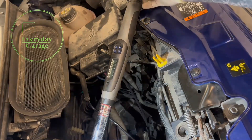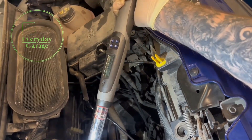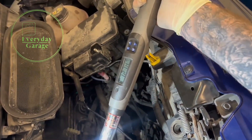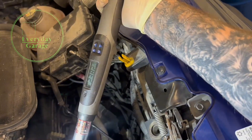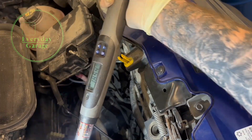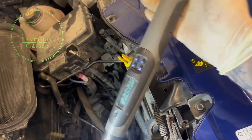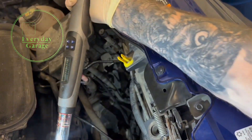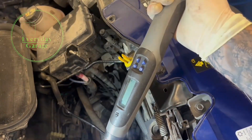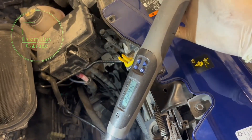Working on the first of these injectors now. On the torque wrench you can see 238 newton meters and we're just starting to move. It's still moving - it hasn't hit 250, about 238 is the highest I've gone. The injector is finally starting to come, still just over 200 newton meters.